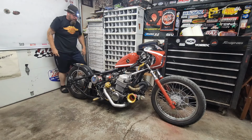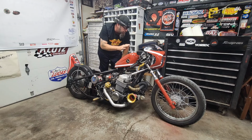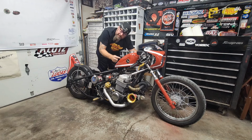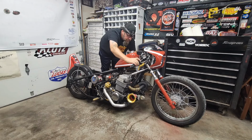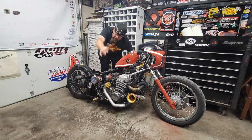And what I'm adjusting, guys, I didn't turn up the RPM. I'm adjusting the ignition pullback. I have my button over here. When I hit the button, it pulls back the ignition to help build boost, so it fires late and fires into the turbine and spools the turbo. Let's see what it does. Best part is, I know the tune is safe now. We're good to go.